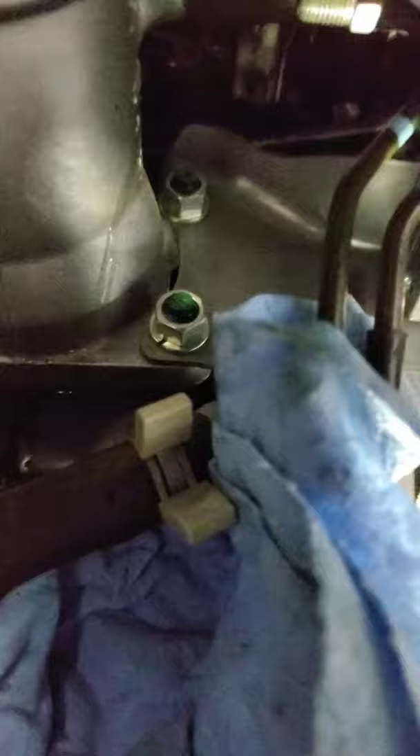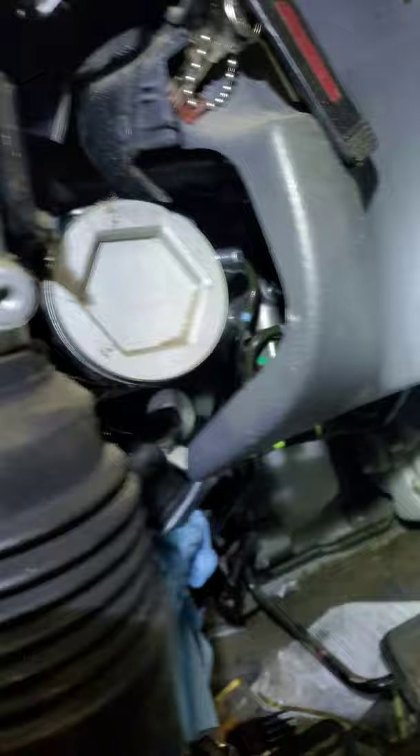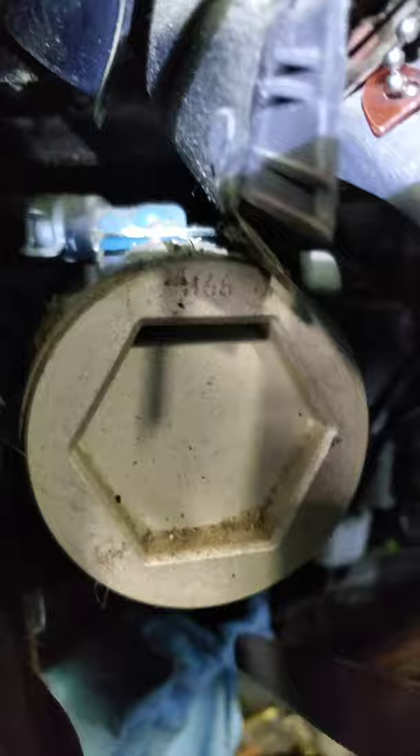Back to it — there are the two lines, one out and one not. There are still two lines on top. We're going to go ahead and get to these four bolts, one on each corner, pop those out, and try to keep this moderately clean. Now we've got a much clearer shot — you can see those lines. Looks like just pinch clamps on this side. That one right there in the center is one of the existing old brake lines.